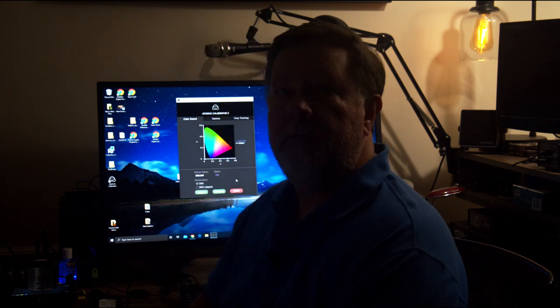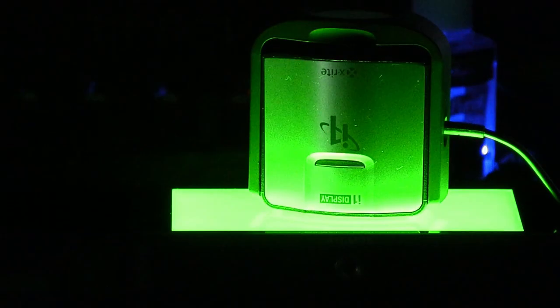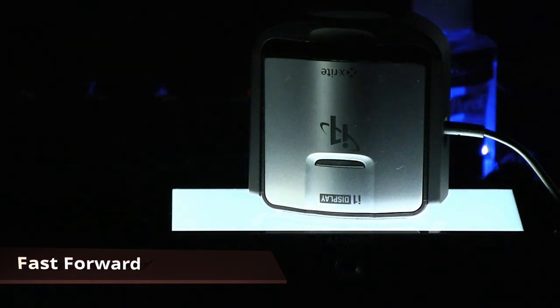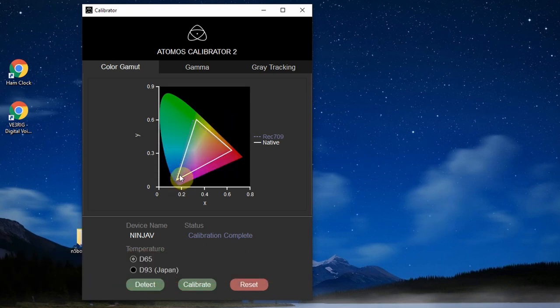Let's turn off the lights. The reason I'm turning off the lights is because we don't want any extra light going into our system. OK Google, turn off the office lights. Now it's very dark in here, but you can see my Ninja is laying right on there. I'll shield this from my monitor. Let's click calibrate. My monitor has been on for a few minutes, and you can see it's changing colors. Calibration is complete, and you can see it did shift it some.